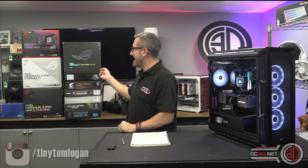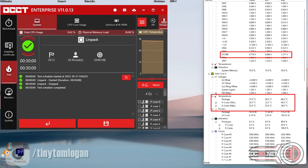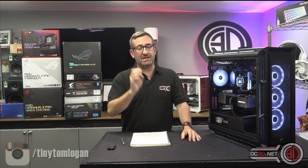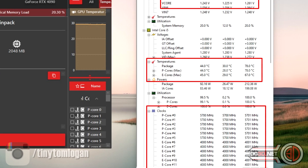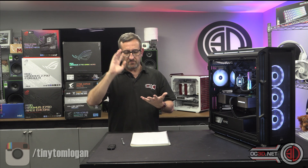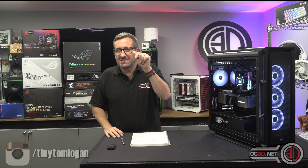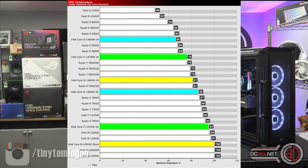I've put the i7 and i5 into every board I've tested just to double-check voltages, and they were all pretty much the same. The i5 was only about 1.25 volts at stock anyway and the temperatures were great. I still managed to turn it back down a little bit, but the best part about the i5 is its overclocking — 1.25 volts actually got all cores running at 5.7 GHz. For me it was the most rewarding processor to work with.